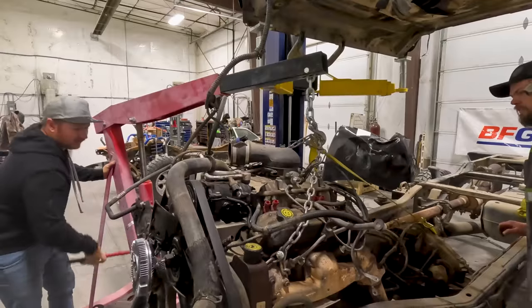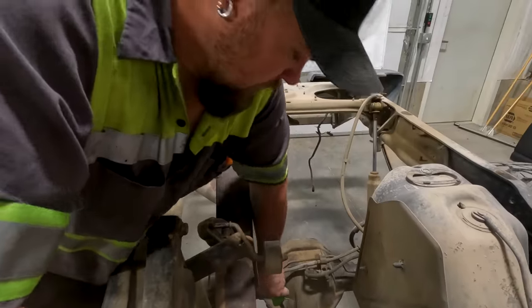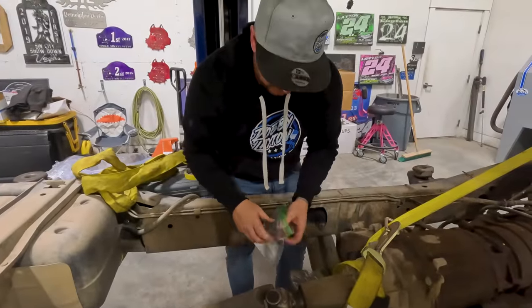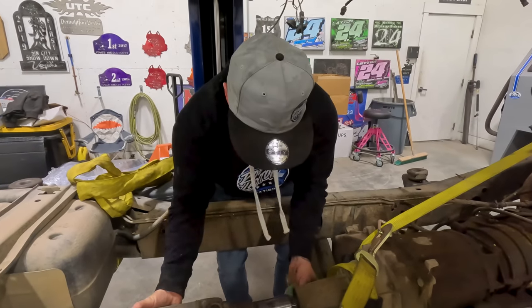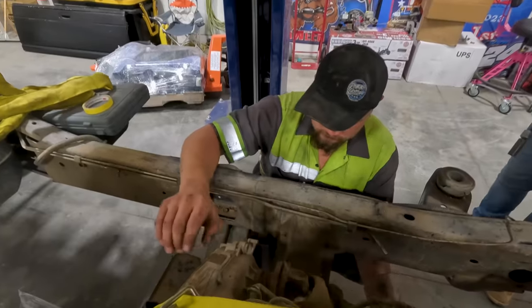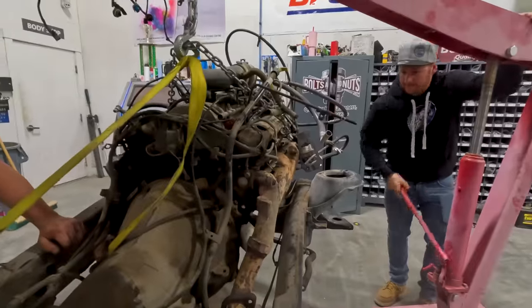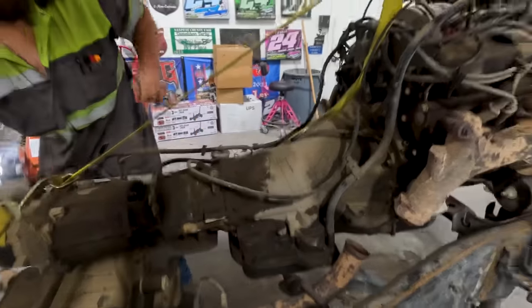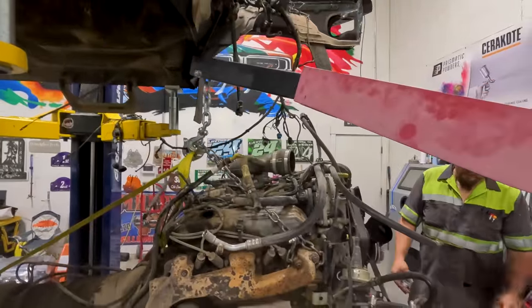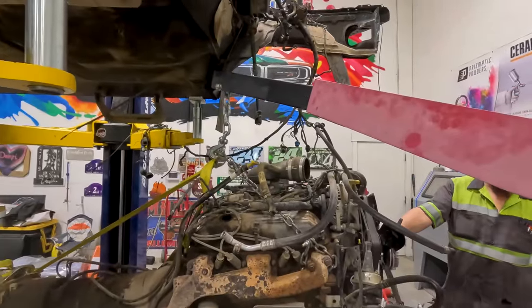The motor's going up. Just getting the rear drive line popped out. I'm going to put a baggie over the end so we don't get fluid everywhere. Then we're going to pick up the frame a little bit and drop this jack stand down.